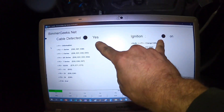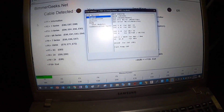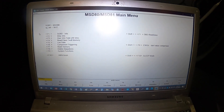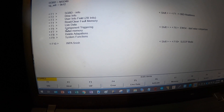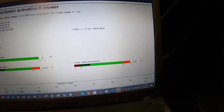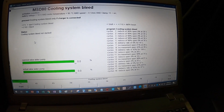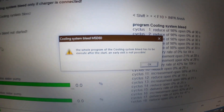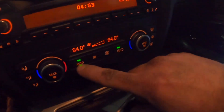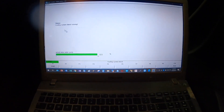You should see the two lights go black — ignition on, cable detected. So now we want to go to N54, loading the program. Then we go to component triggering, F6, then F8 for water pump. And now we want to do a cooling system bleed. When we start it, it's asking us if we're sure we want to do it — yes. It's telling us temperature at maximum, so let's get the temperature up to maximum. Then it says press the auto button and reduce blower output to a minimum. It's at a minimum. So now we just go like this and it should start cycling the pump.